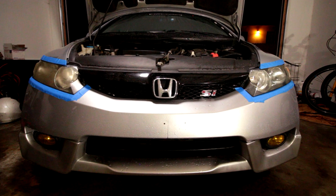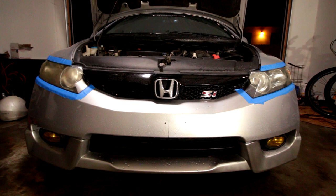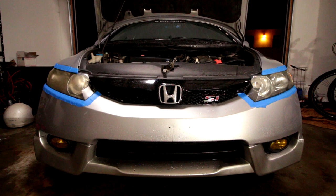Pulling the camera back a little bit so you can see that the right side headlight has had two quick rounds of polishing done to it, and the left side headlight has been untreated. There is a clear difference — the right side headlight is obviously much clearer, but there is still some haziness and some oxidation to it. Looks like we have to carry on with some light sandpapering with the rest of the kit.